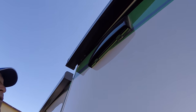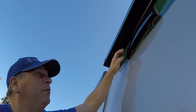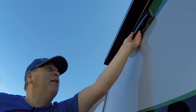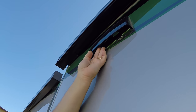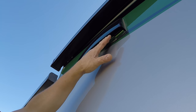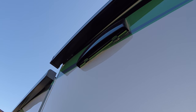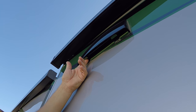One of the things you're definitely going to have to do — and you're probably going to have to do it yourself — is open this vent. By default it will be clipped closed, and what they do before they put this cover on is they clip it closed in the factory when they build it, then they spray over it. Some people have had to cut away the paint. Fortunately ours opened quite easily and then we put some velcro, but basically I'm going to velcro this open so it doesn't flap. Obviously if we store the vehicle we'll clip it closed — it's meant to stop rodents. But if this vent is closed, any cooking you do inside the vehicle will cause the smoke alarm to go off.